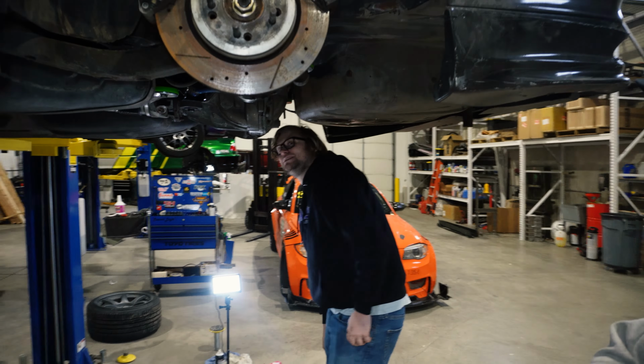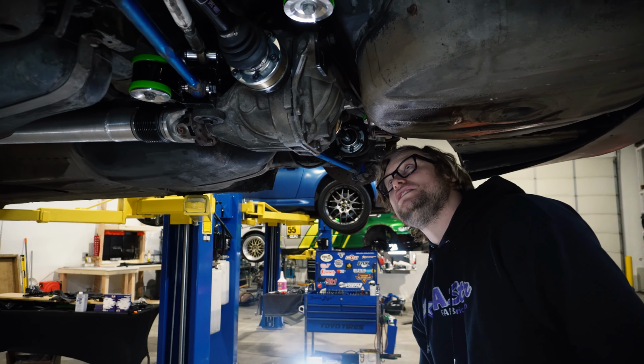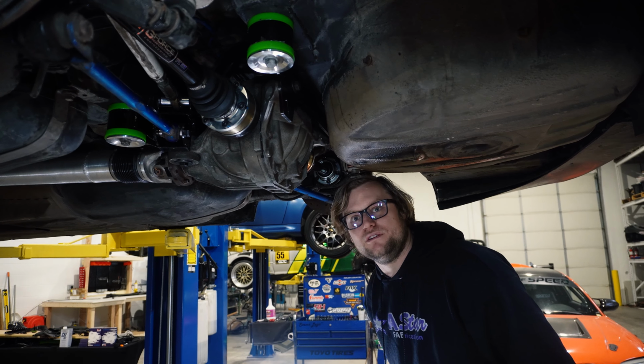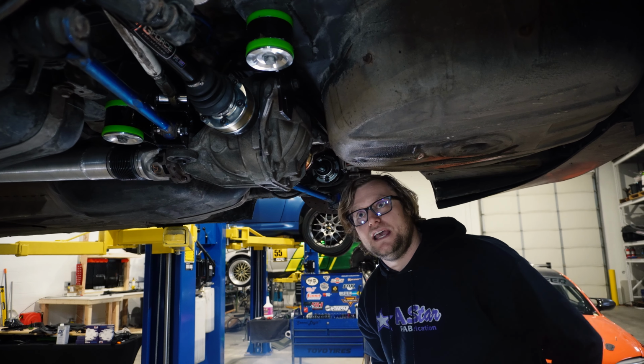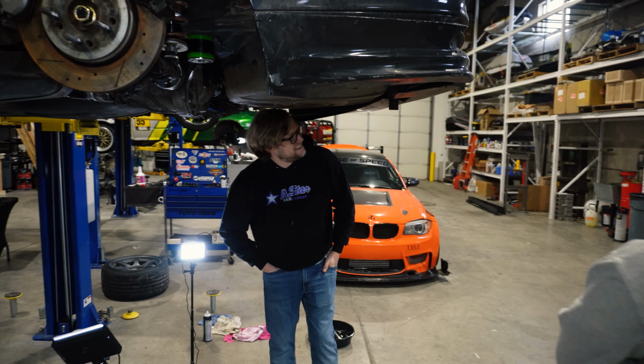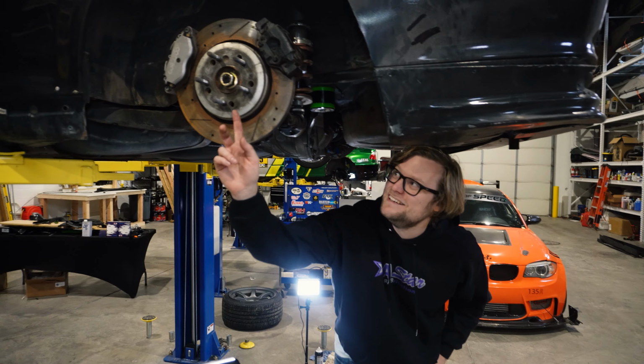So I guess next is we'll fill it with fluid, put the exhaust on, and add a vent hose to the top of the differential so that it doesn't spew any fluid up if he's doing some kickflips, and we'll go from there. So it doesn't end up like the last kit. Yeah, 200 even. 200 foot-pounds for this, sorry.